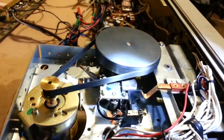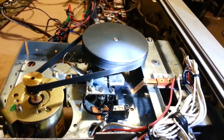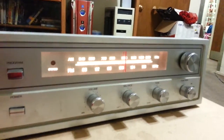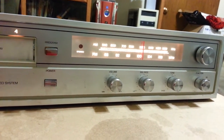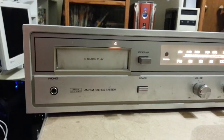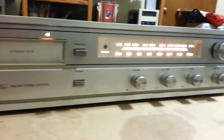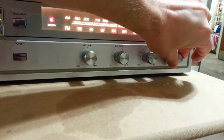With everything continuing to work properly, the head now fixed, and the programming switch now fixed, let's give it a listen. First, let's go ahead and power it up. It's a very, very pretty player. You can see it has a very nice backlight. Very good reception of radio as well — it'll do AM and FM, and it has an auxiliary. Those lights weren't originally working on the 8-track player, but they do now that I've got the bottom repaired. The contacts had actually come loose for those, so that's another thing I'm glad to have operational.